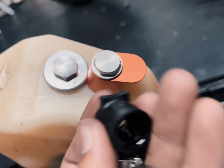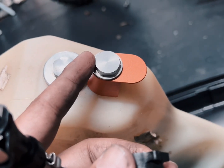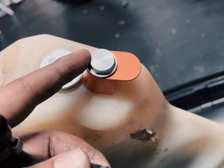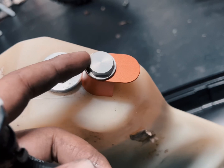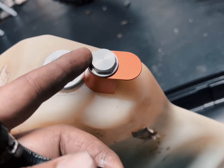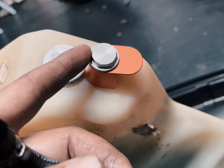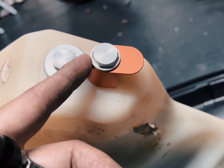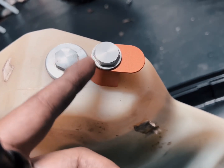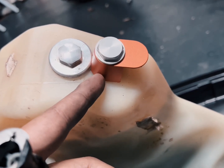And you'll take note that as you open this bolt, it's a size 17. This is the KTM 250 XCW 2022. It wasn't so tight, and also when I put it back, I never made it so tight. So it is tight. The seals are sealing, but it's not so tight where you can actually spoil the threads on the fuel pump inside.